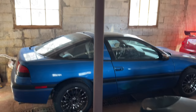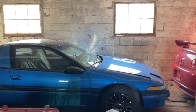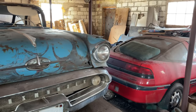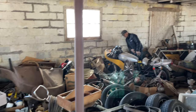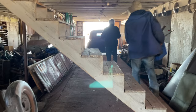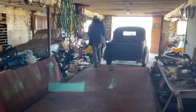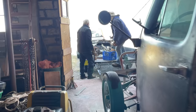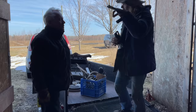See, now if you do it properly, you take it apart, make everything perfectly clean, and then you solder it back together. But when you're trying to fix like a crack, it's dirty and the solder doesn't work well. Okay. Well, I wouldn't mind taking the old one. The one that's in the truck, of course, came with no radiator. That radiator that's in it came out of the 8-cylinder car. But I got another radiator that came out of a 41 6-cylinder car, and that's the one that I had in it for a little while. But the cores need to be flushed. Needs to be taken apart and brushed out. I take it to the radiator place. Like in the old books, they used to take them out and they had a tool that would go down and clean them. But anyway, the cores is always good to have.